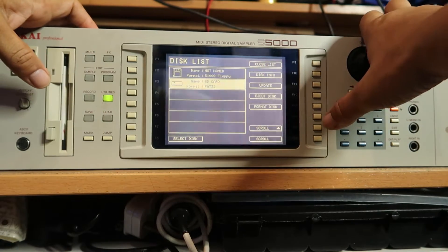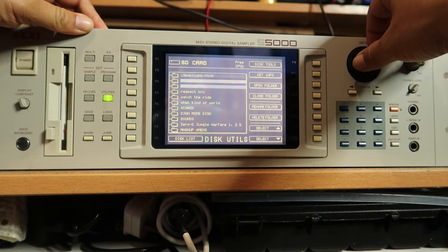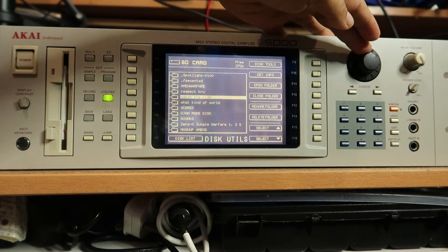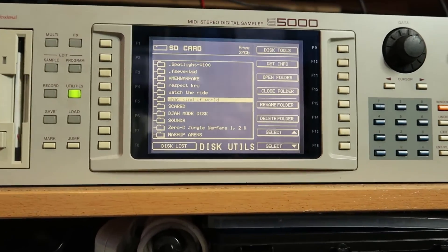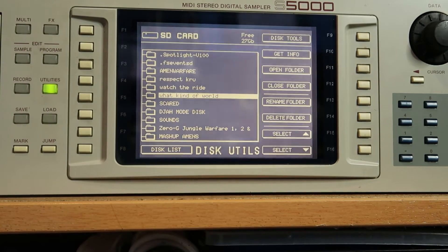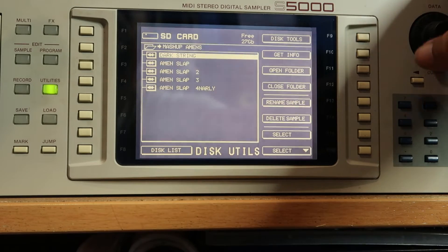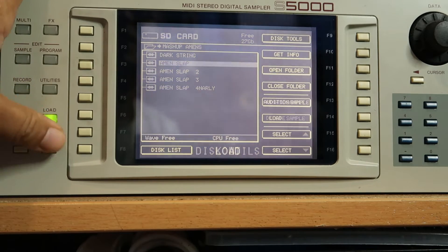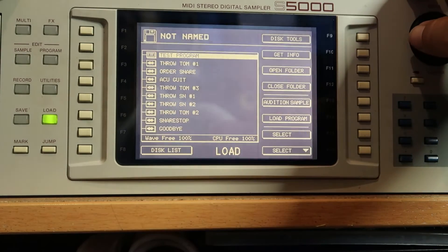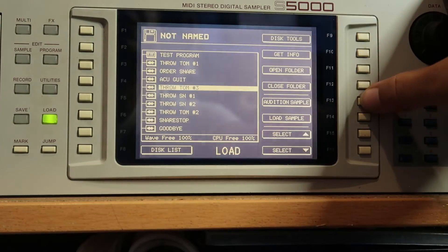If I show you here, I'll click that, select the disc, and look — it will select the disc. All of this is actually the disc image on the RaSCSI. You can load from it, you can save to it — there's a lot you can actually do, which is really cool. As you can see the batteries are running out, which is a bit unfortunate, but it's all working. You can go into different folders, open a folder, audition samples, and load them as you would with a physical disc. I'll select that disc and go to load program, hit execute — program load complete.